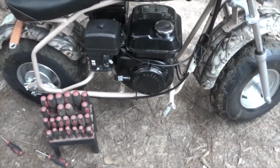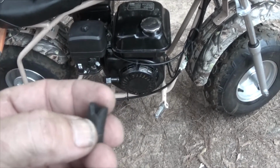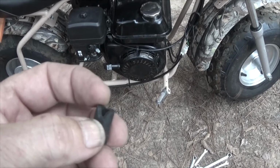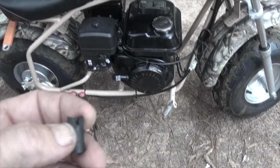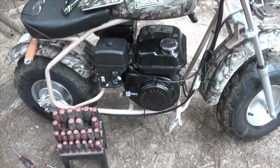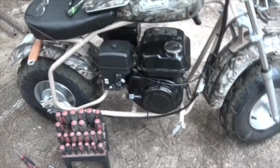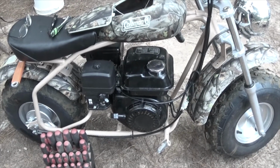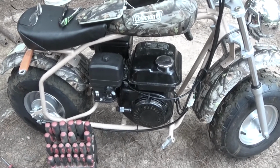Okay, put it back together. I still had a leak. Right here, you can see this micro tear that was in the fuel line. I cut this out, and this piece ripped off when I did. So I clipped that. I now have preserved in that tank whatever amount of fuel I had left after it had dripped out. Now, I didn't have a lot of gasoline in there to begin with, but I have essentially lost 3 gallons, or about $6 worth of gasoline, because of this little bitty tear.